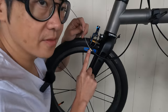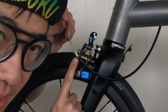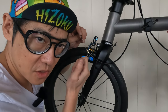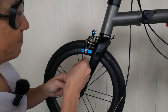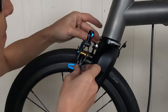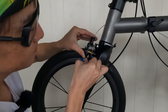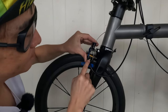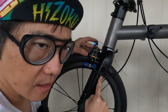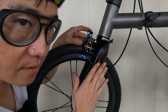This part of the cable end needs to go into the piece right here. This is the stock piece that was on the bike — the cable end. Sometimes you may have to sand or reshape the end of it so it's perfectly round to get it in. You'll notice that the cable routing is in the same location as the stock one — I can tell because the rub marks are in the exact same location. So this cable should work fine.